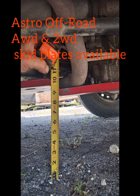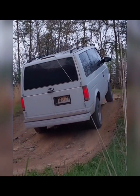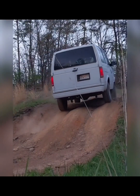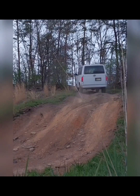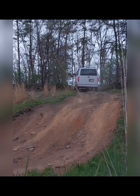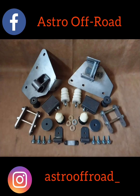A general guideline for overlanding is to have eight and a half inches of ground clearance, which is achievable with just a half-inch torsion lift and 29-inch tires. So if you're in the market for a lift, or maybe you already have a lift, or you don't want to run a lift and just want to run a larger tire or improve off-road performance — feel free to contact us and we can discuss your personal needs, whether that's just a set of our extended bump stops or perhaps a full Swashbuckler kit. Thanks for watching, and be sure to hit that like and subscribe button for more content like this.